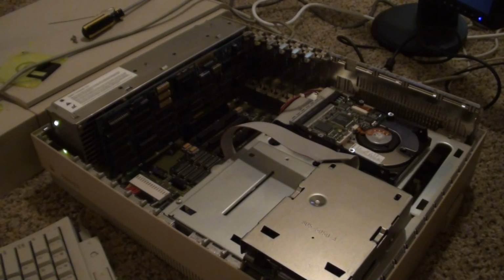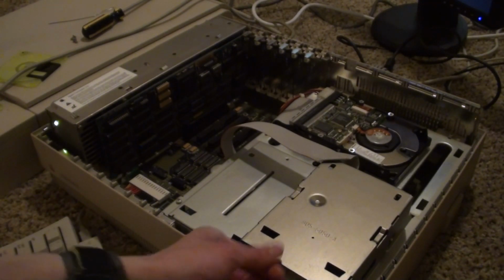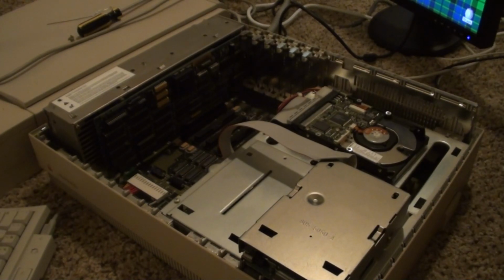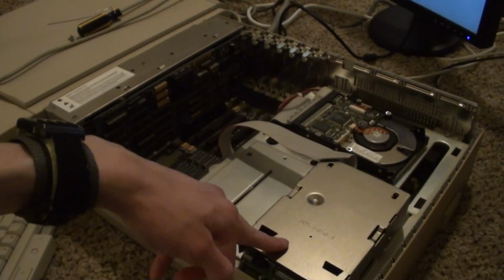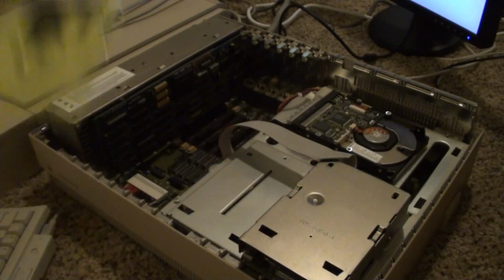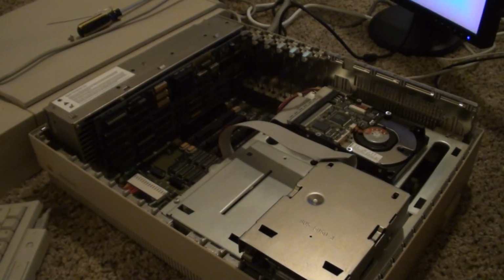Okay, I didn't like it. Macintosh Basics. No, don't go back in! Okay, took me an hour, because I couldn't find the disk I already made. But this disk is an 800K floppy, this is an 800K drive. This has bootable System 6. Maximum OS on this should be 7.5, so this should work.